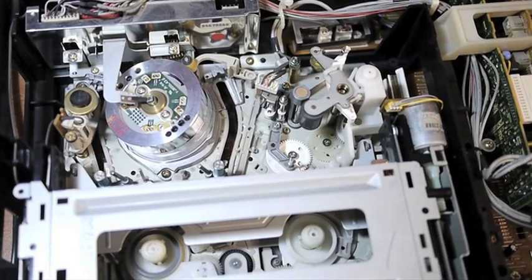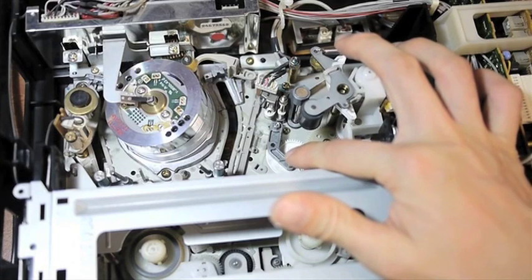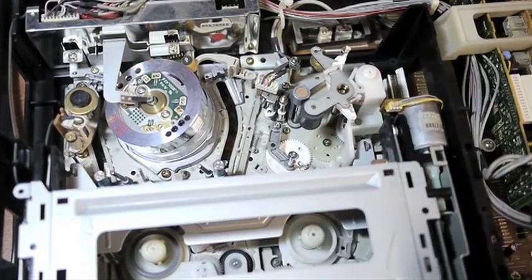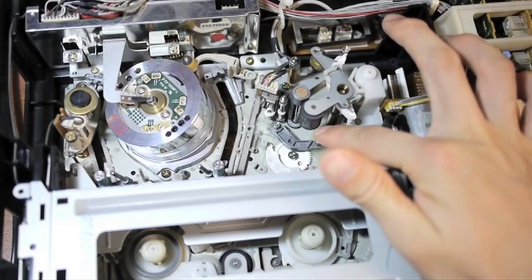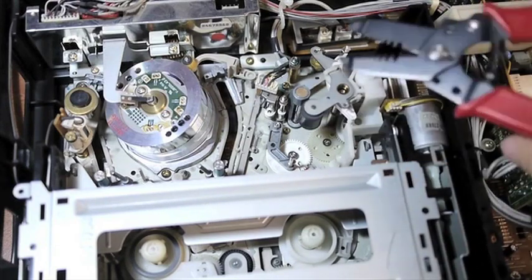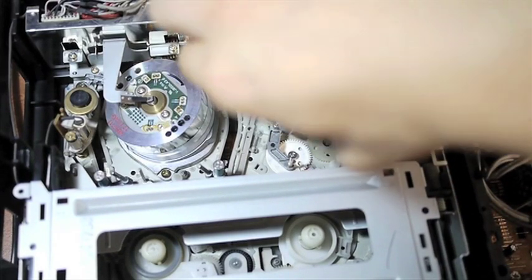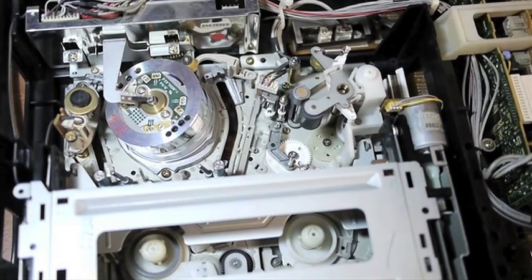The half load arm is a common part that will fail with time. Normally when it's functioning, when you move it out of position, it should bounce back to the original position due to the spring mechanism underneath. With time, it is common to have this part fail because the grease inside becomes sticky, which causes the part to stay in whatever position you move it to. To fix this problem, it's actually quite simple — all you need to do is take a plier and gently unscrew this bolt here. Once you unscrew the bolt, you can lift it up and clean the inside, then re-lubricate it with WD-40 or other lubricants. It's an easy repair.